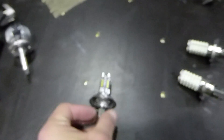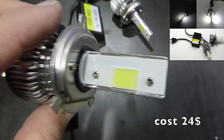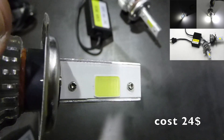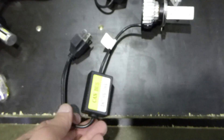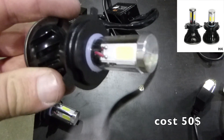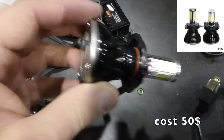For the second type we have some LEDs on the side and one or two at the ends. Then we move up to the Cree LEDs which have a higher light output, and because of this they also generate more heat — that's why they have a heatsink behind the socket. You can see that these two are fan cooled. Compared to the two before, this has one LED on each side so it gives a roughly 180 degree spread depending on which of the two are turned on. This bulb here has kind of the same idea but supposedly a better light spread, and it also uses a fan to cool it.